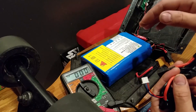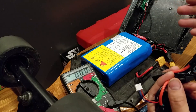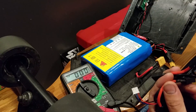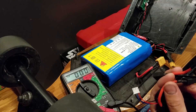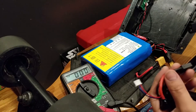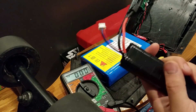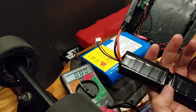The idea is these batteries on this board suffer a lot of voltage sag, so as you ride along you get past around eight to ten kilometers, then afterwards the batteries will sag down to a lower voltage and your board will not be able to accelerate as fast as it would with fresh batteries. So by adding an extra two series of batteries to the board I was hoping to keep the voltage high enough that I would not experience that so soon.